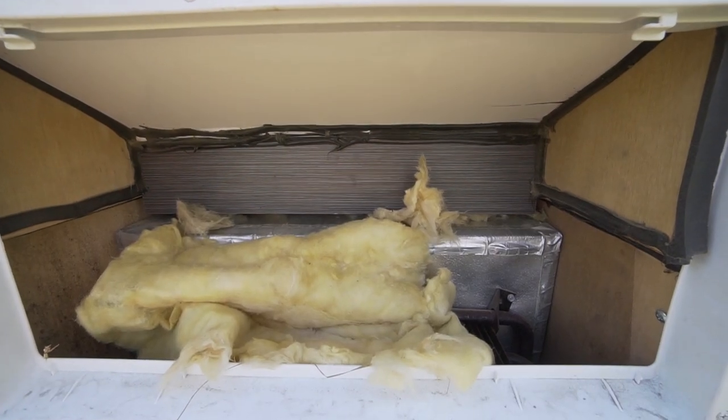Lee is a service manager at Jayco Canterbury, the Jayco dealers in Christchurch — super nice people. He's helped me with so many little things in the caravan, always offering great advice. It was a weekend and I messaged him saying the fridge is overheating and there's this insulation sitting on top. He got back to me straight away and said that insulation shouldn't be there — it looks like it's fallen down. The inside wall of the fridge cavity is insulated for efficiency, but the roof is on an angle and it must have come unstuck and fallen down over the fins. It was pretty hot under there. He said to tuck it out of the way or pull that bit out.